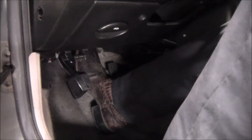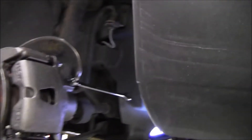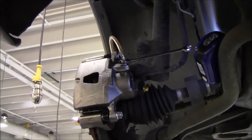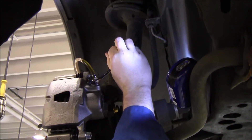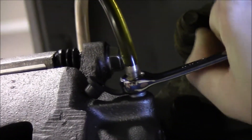This type of bleeding is called manual bleeding, where you pump up the brakes. The person inside the car will hold the brakes after they are firm. The person down below will then go ahead and open the bleeder valve once the person inside tells him he is holding the brakes. You will see some fluid come out. Then he will go ahead and re-pump the brakes until they are firm, then tell the person outside the car that he is holding. And that is how you manually bleed the brakes.